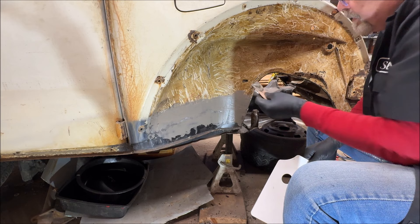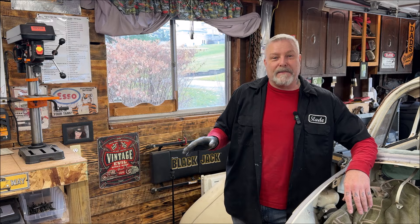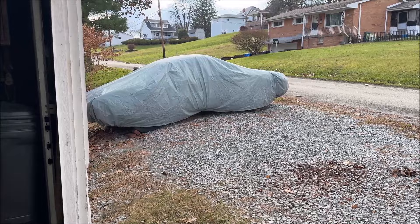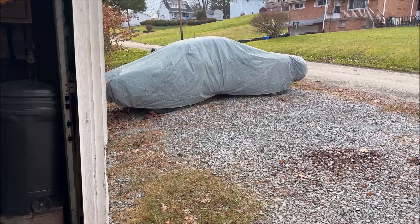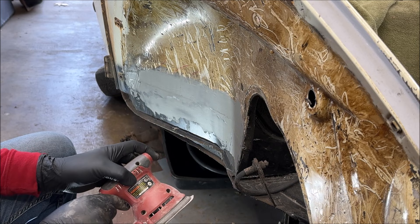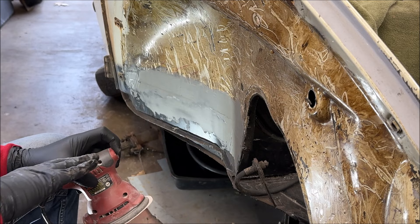This stuff is three to five minutes working time — that's not very long. You put like a three-inch circle, half-inch thick, and 35 drops of hardener, which is a liquid. I got my metal bondo fixed up. Some of you body men out there will say don't use that, but use what you prefer. This stuff does set up quick so don't play around — that's why I had the camera already ready so I could get it on and get it done before it hardened up.